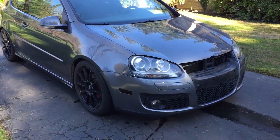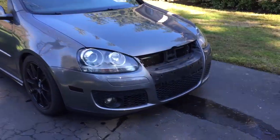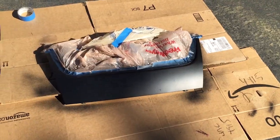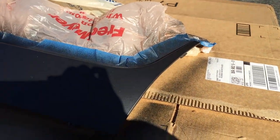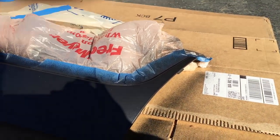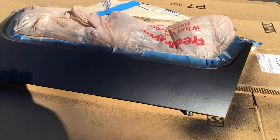It'll look fine from a distance. Maybe just keep it like that — maximum air flow. Okay, we've left this to dry for about an hour with one coat. You can see it's a little bit smoother looking, but you can still see the blemishes. So we're gonna go ahead and put another one or two coats on. Another thing to mention is you don't want to spray in direct sunlight like this — before it was kind of coming through the trees but we're gonna have to move locations.